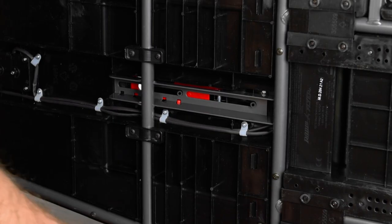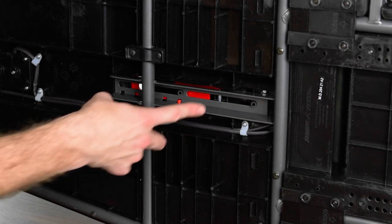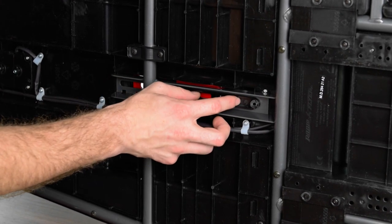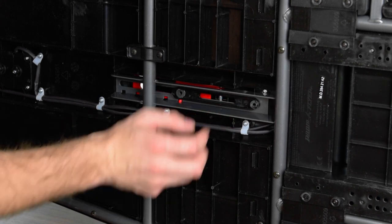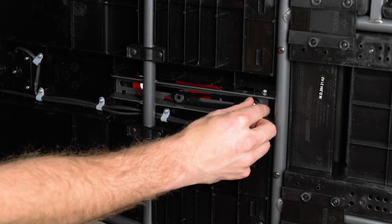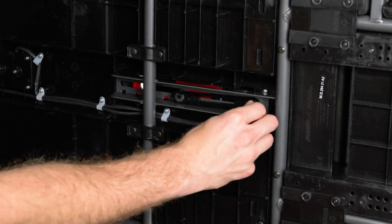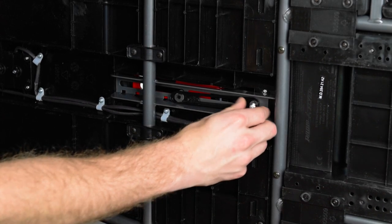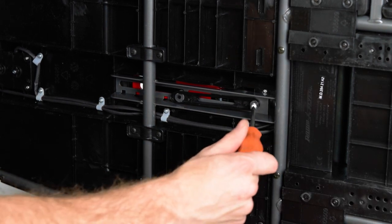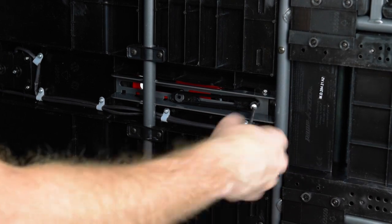Flip the product on its side. Ensure that the seat slider is aligned in the correct direction with the front facing closest to the steering wheel and the flat side flush against the bottom of the go-kart. Use two M5x20 screws to secure the seat slider to the underside of the go-kart by lining up each hole on the seat slider with each hole in the center of the go-kart body.